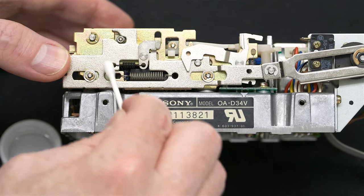You don't want a gap around it. Make sure it's pushed down all the way, and then you can start putting in your Torx screws. Don't screw them down too firm. Just loosely put each of them in. And remember that there are five of them because one of them goes just above the PRAM battery. And then the two in the handle.